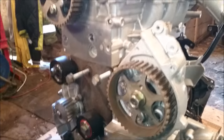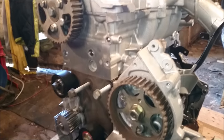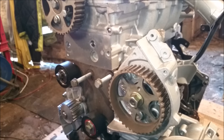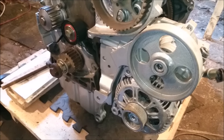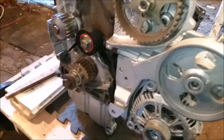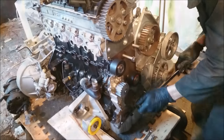Once we've got it timed up, that's great - we're just waiting on a mount now. I'll discuss that in the next video because it's quite a crucial and very difficult-to-find component to make the 8-valve block and 16-valve head work in your 307, 306, or whatever you're building. So we'll get this belt on, get it timed up, and then have a look at fitting the auxiliary system as well - my pulley has turned up, and I've got my air conditioning pump to go on down there, then we can put the belt on and sort of shut up this side other than the mount. I've just realised that's four minutes, but it's explaining some crucial components to make this configuration work. It is sunny, which is nice, but it does mean it's about minus three.